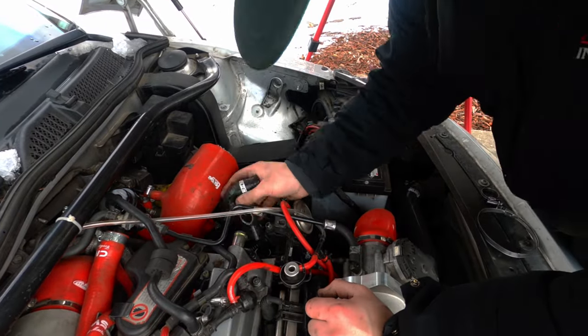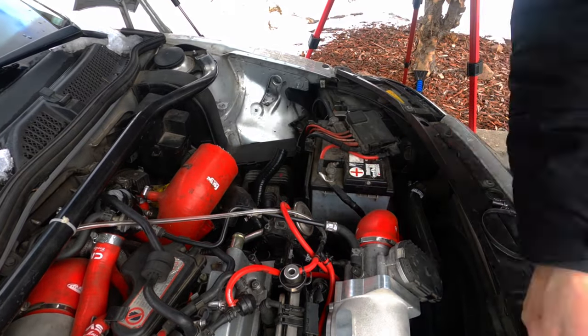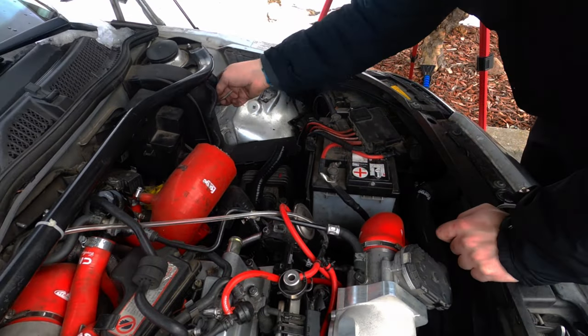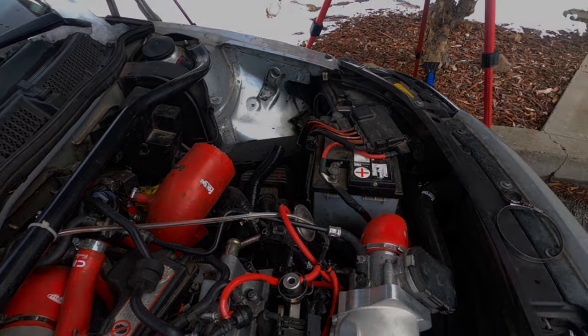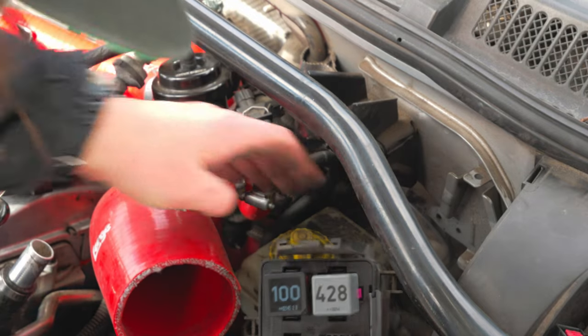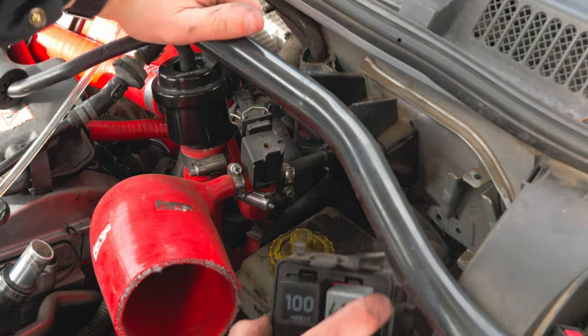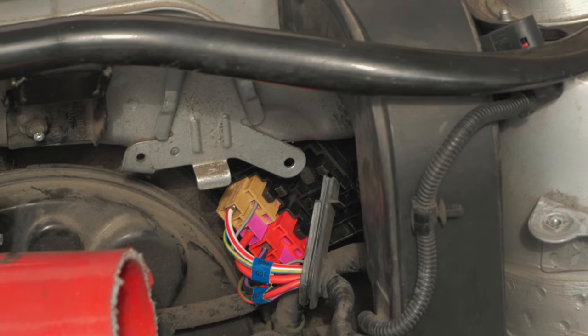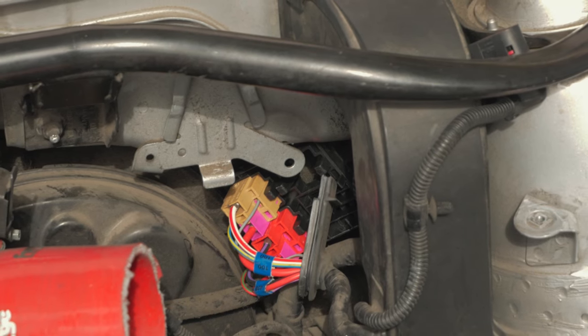There was one breakthrough from the GTI guide which made a lot of sense with this car, and it had to do with where we were going to mount the catch can. While this is technically a Mark 1 TT, it is also a Mark 4 platform, and that means they share some similarities — one of which being this relay box right here. For a GTI, the instructions say to dismantle the cover and slide it into the firewall, which gives you enough clearance to mount the catch can. Turns out those same mounting brackets are on the Mark 1 TT, and this location is actually perfectly valid for the catch can.